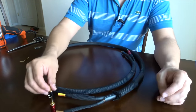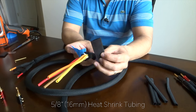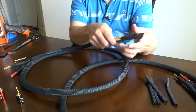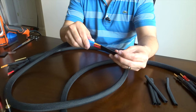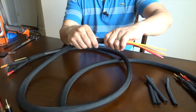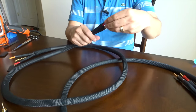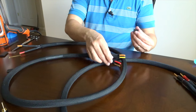Here's a little tip: sometimes the heat shrink wrap is hard to slide on after you've put the braided nylon sheathing on top. What I do is just tape this end with electrical tape or painter's tape — doesn't matter. Then you can slide the heat shrink on easily. This will hold it without moving the sleeving. After that, you can remove the tape and make sure everything is relaxed. Red and brown, orange and yellow — just to make sure the conductors are correct. Then let's put this loom on.